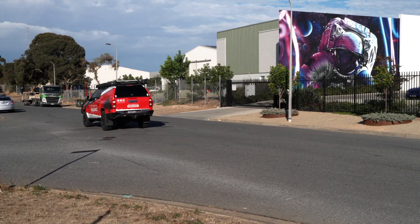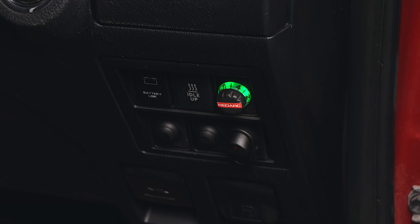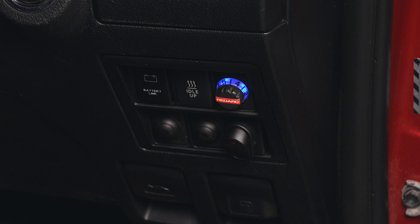We recommend you conduct calibration on a sealed, smooth and quiet road. If a trailer is used during initial calibration, the trailer brakes will function as if in manual off-road mode, indicated by the LED remote glowing green with blue flashes. When the brake is applied, the LED will pulse green and red. As the TowPro becomes more confident of its direction of travel, the length of blue flash will increase until the LED is solid blue, indicating it is now operating in everyday mode.